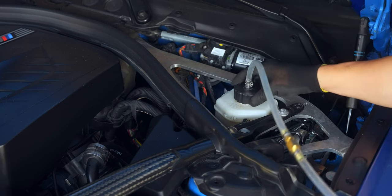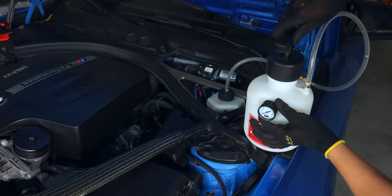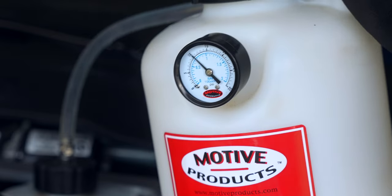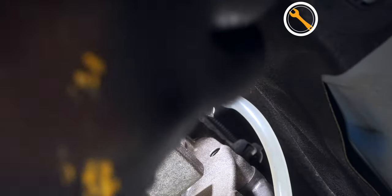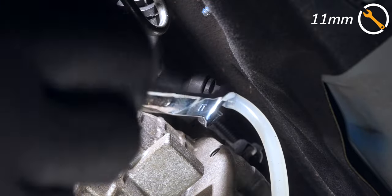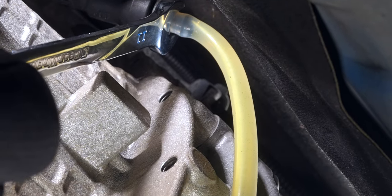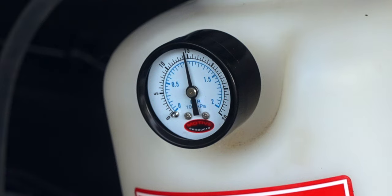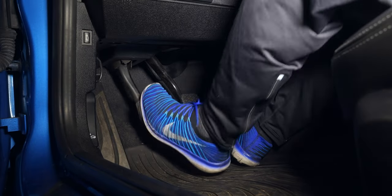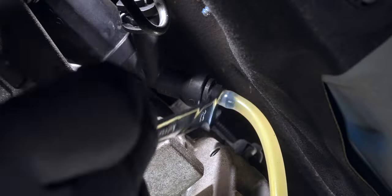Add a small amount of brake fluid and pressurize the system to 15 psi. Back underneath the car, open the valve with an 11-millimeter wrench and you should see some air bubbles come out with the fluid. The fluid drain should be so minimal that there's barely a pressure drop. On the other hand, if you're doing the pump method, open the reservoir and have a friend pump the clutch quickly to help it move along the line. After the bubbles have come out, instruct them to hold the pedal down as you close the bleed valve.